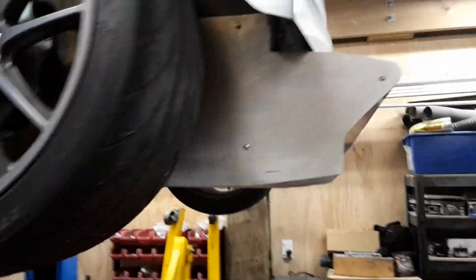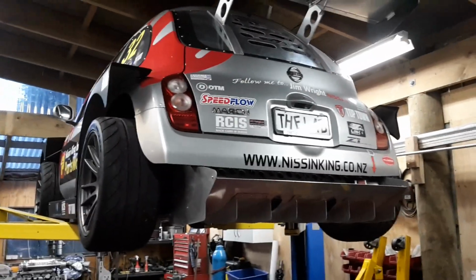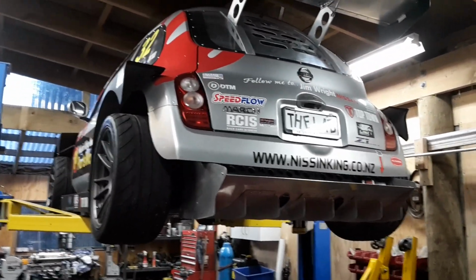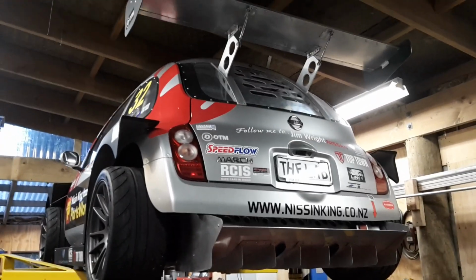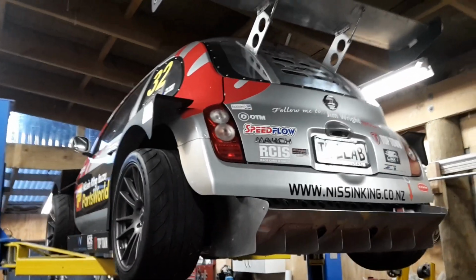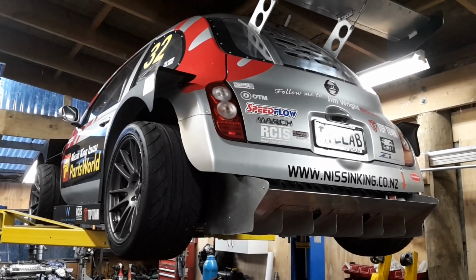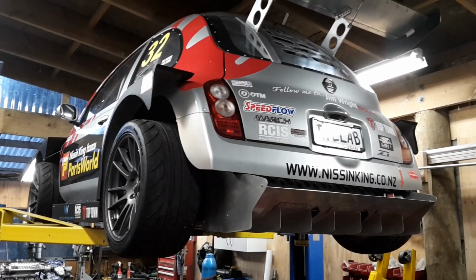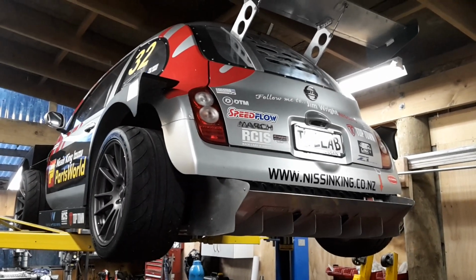So we had that drive shaft failure, we fixed that and everything else that was going on there. We did Speedshow. I checked the car after Speedshow. I found that little screw that had come out of the air filter. That was a tragedy. It destroyed our Garrett turbocharger compressor wheel. So brand new core in there, thanks to All Trans Diesel and Turbo up in Auckland. And a couple of little tweaks on the compressor housing, which won't amount to much, but we did them anyway while I was out. So that is pretty sure ready to go.